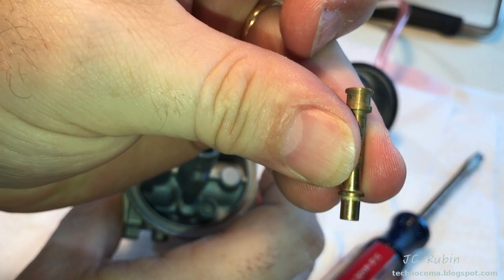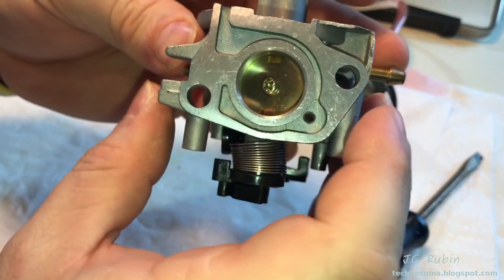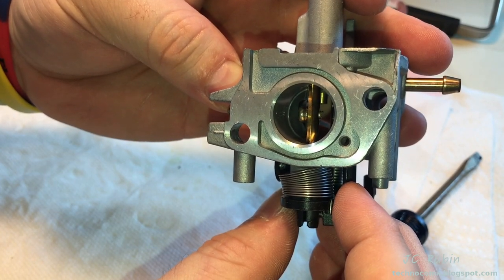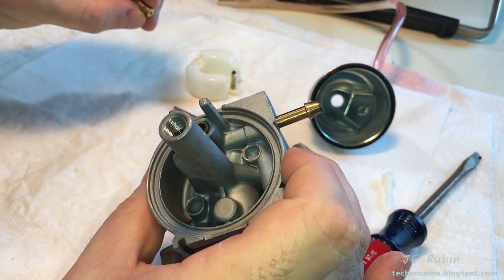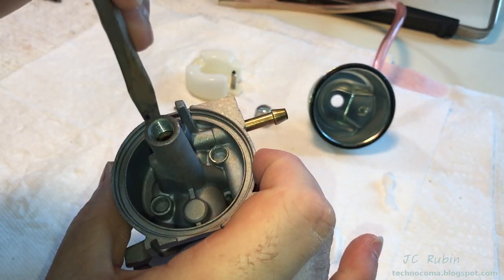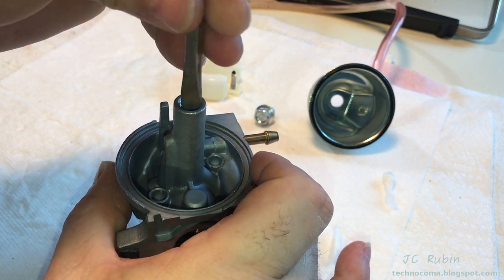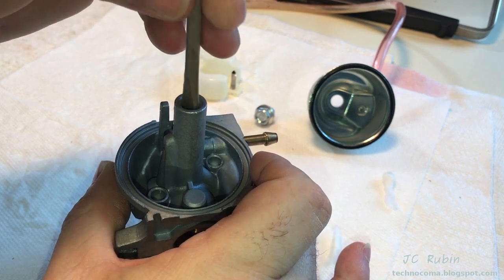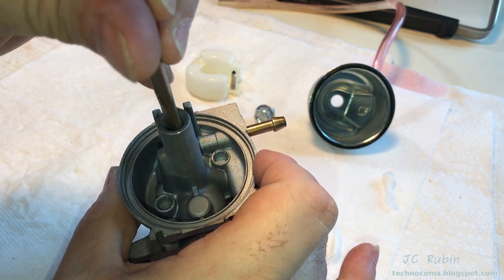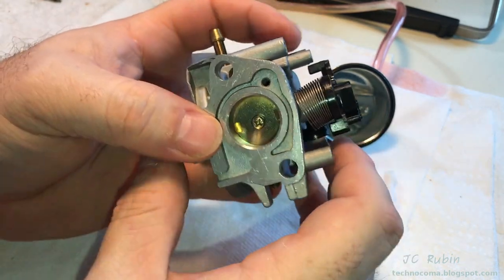Drop the emulsion tube down skinny side first and shake it down. Opening up the throttle body, I can see the port is right there off to the side up top — fully seated. This is followed by the jet, with the screwdriver slot pointed upward. Using the same fitted screwdriver, I'll tighten the jet back down until I feel it hit full seat. Notice I'm just using my fingertips on the screwdriver — not even using the handle. When I hit the bottom, just give it a tiny nudge with the handle. Don't over-tighten it or you'll break it, and that will cost a lot of money.